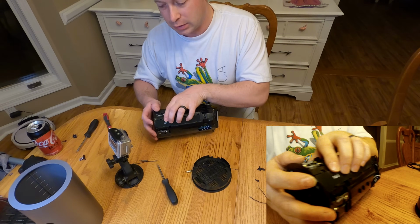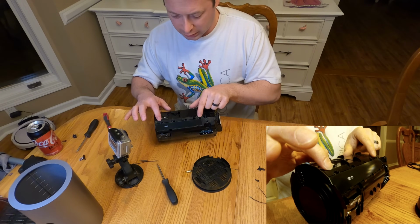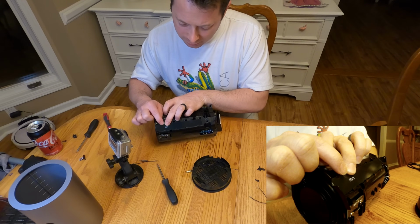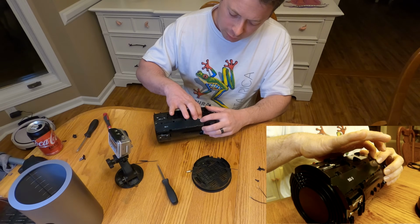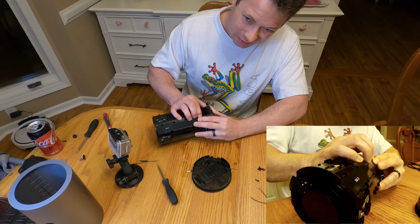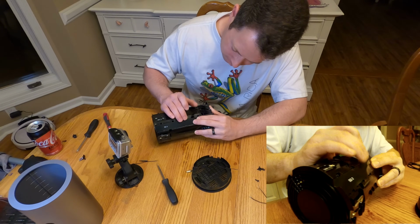To get the antenna back secure, you just clip in the bottom piece, and then it has these 2 clip retainers. So I just press it down, and then I take my finger and I try to pull back on the clip so that I don't have to press on the antenna hard. It can be a little bit cantankerous for sure.